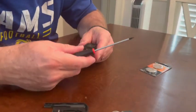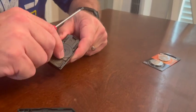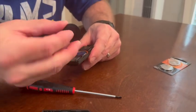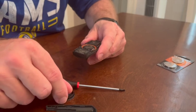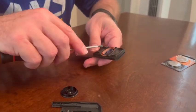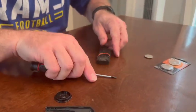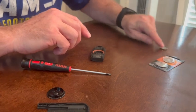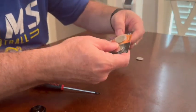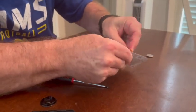On this side, we have this black disc. We're just going to pop that up — don't even need the screwdriver, just pop it up with your fingernail. And there is our old battery underneath there. We're going to pop that out. Always watch the orientation — the brand side was up and this side was down. This is a Duracell 2025; I'll put an Amazon link in the video description.